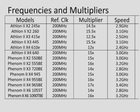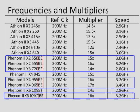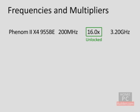To overclock the CPU, we have to increase either the reference clock or the multiplier. With the exception of the Black Edition CPUs — also known as BE in the model number — all Phenom II-based CPUs cannot increase their multipliers beyond the stock setting. You can lower the multiplier, but increasing beyond the stock setting is not possible. The Black Edition CPUs have an unlocked multiplier, which means it can be increased beyond its stock setting. Leaving the reference clock at standard, you can simply increase the multiplier to increase the speed the CPU runs at.